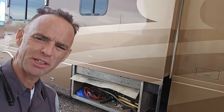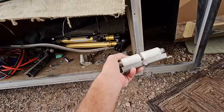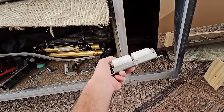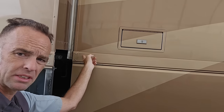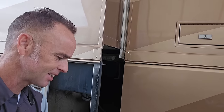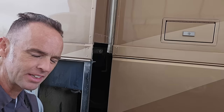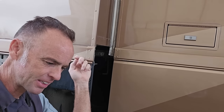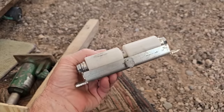Here's why I did that — I got frustrated. When I left you guys off, I was just using this adjustable roller so I wouldn't have to worry about shim heights as I was building. I got hyper-fixated on lining up the belt-line molding here rather than lining up the paint lines, because the paint lines are where the factory originally had it. The belt-line has differences between the slide-out box and the sidewall itself, so I shouldn't have been hyper-fixated on the belt line.